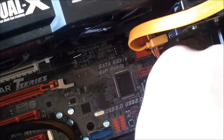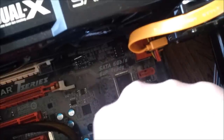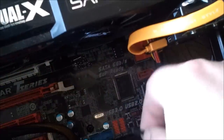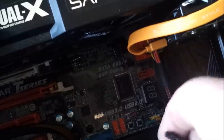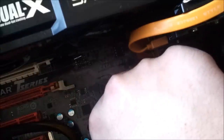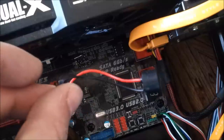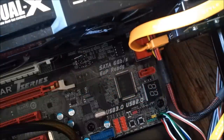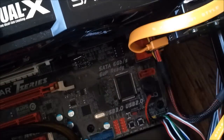There's the front I/O — that's for your power switch, your reset, your HDD LEDs, and your power light LED. Just put those into the corresponding color. They're tiny and in a tough spot, so I'd suggest doing that first after you get your 24-pin and 8-pin power in, before the GPU is in. There's also a speaker that will post any error codes you may have — hopefully it's just one crisp short beep and your system is up and running.